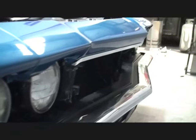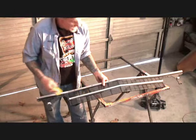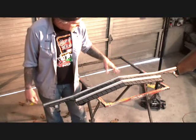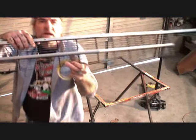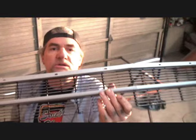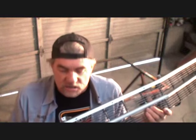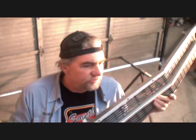On the '69 Chevelle, the grill did not have silver paint in there — that was blacked out, just like the bumper filler down there was blacked out. You can see where I painted that flat black or semi-gloss black down there — that was the Chevelle color code. So naturally you would take that and run it right through the grill to match it all up. The owner's had this grill since the 80s. What we're going to do is customize this to a Chevelle grill by painting the grill fins — these inserts — black. We'll tape off the silver part where the chrome goes and leave those silver for color code correction, then take a high-quality spray can engine paint and paint it black to match the Chevelle.